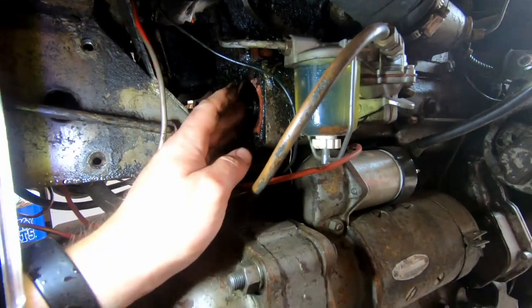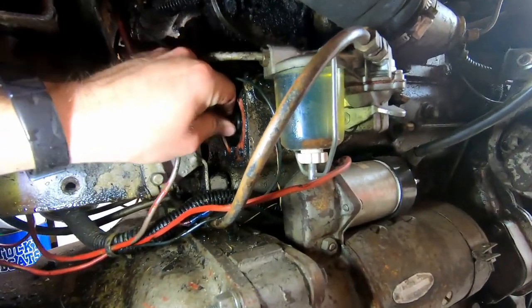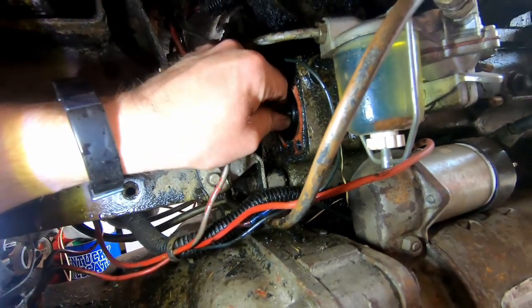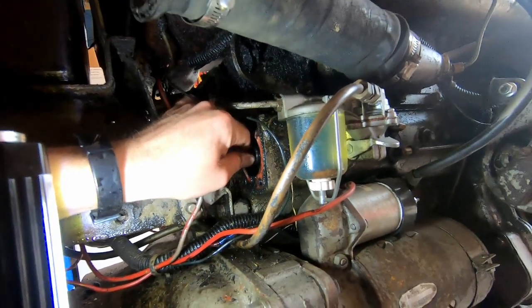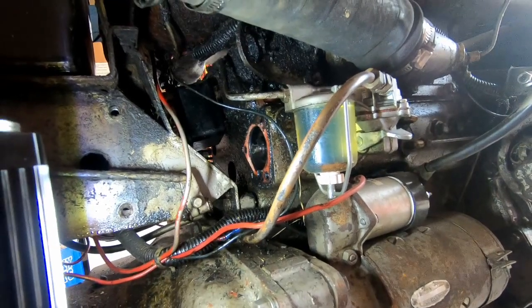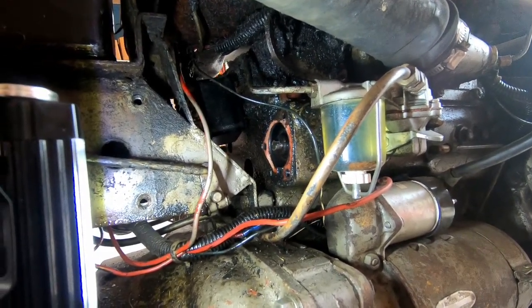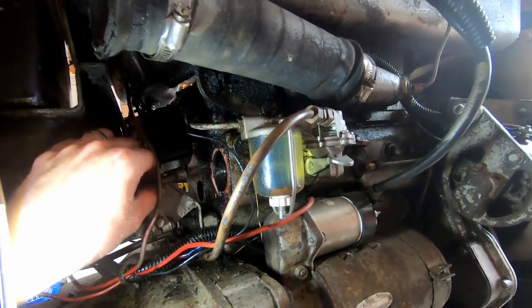What we want to do is inspect that — see if it's loose, if it's turning inside the cam. This one is not loose, definitely not turning inside the cam, so that's not the problem. But if yours was loose, what you might want to do is put a little bit of Loctite on it and put it back in and see if that'll snug it up.